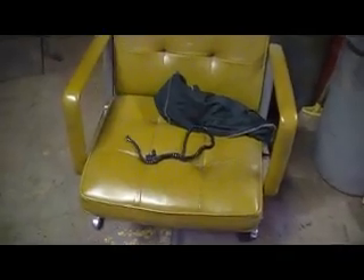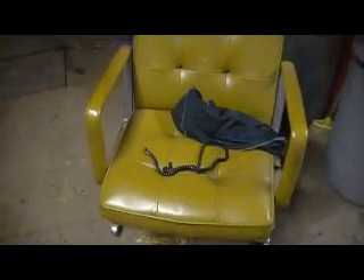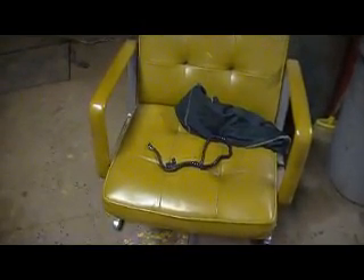Right now I've got the chain out and the rocker assembly off. The quad's over here in the back of the shop. I'll get back to you tomorrow and keep you posted on what's going on with the camshaft that does not turn. I'm hoping it's just a broken or burnt-out oil pump, because otherwise it's going to cost a lot of money. Little foot's dead.